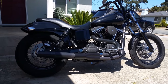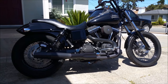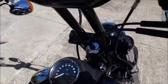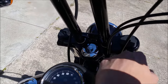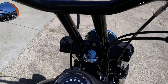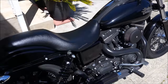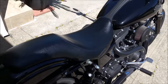The shop set it up standard — I told them I'm 205 pounds and they set the preload for that. I haven't messed with the settings yet. For the forks, one side is the spring and one is the dampening, so you can only adjust on the dampening side. Right now it's just on the standard middle setting, nothing aggressive — I'm still playing around with it.